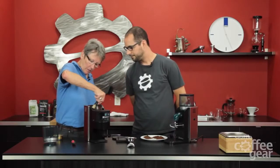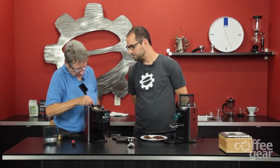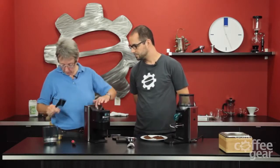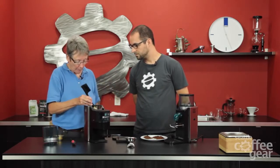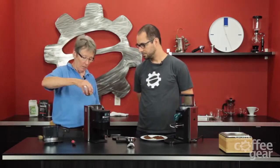And when I take it back downstairs, we'll take an air gun to it. That's a nice way of getting the residual stuff out. So you want to clean it. And the threads in here that this threads into, make sure they're kept clean, because that will bind it up so it won't work. Yep. So it won't thread.